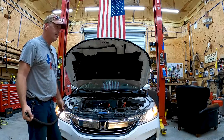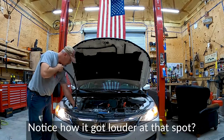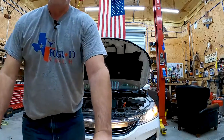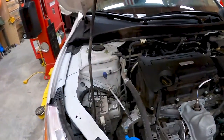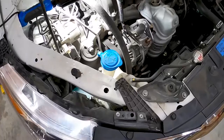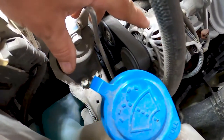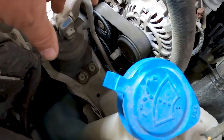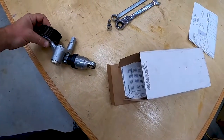It's actually not that bad right now — I don't know if you can hear that. I'm going to show you what it is. It's this pulley right here, the idler pulley. Now I'm going to show you what I'm looking at. This is the serpentine belt right here. That's the alternator. There's what's called the belt tensioner — this pulley right here. And that is the culprit.